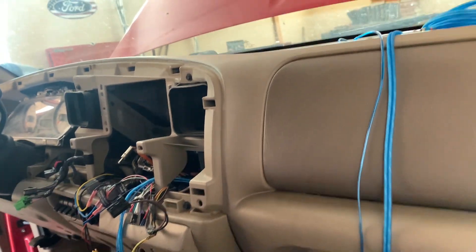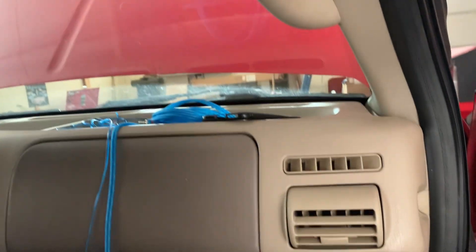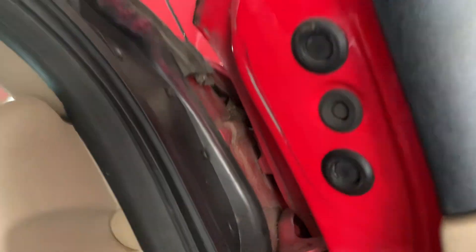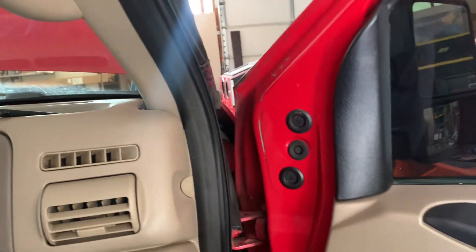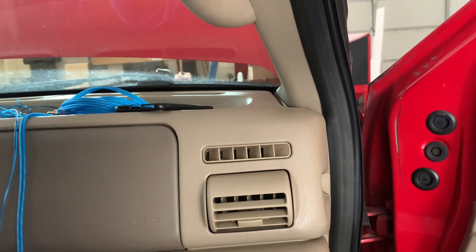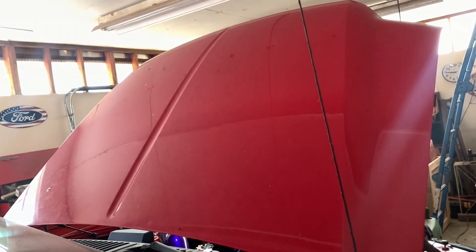Like I said, shouldn't be too bad. Next time I pick the camera up I'll show you all that, and then in a few days — or maybe even today if we have time — we'll go ahead and run the rest of this out. I also need to run my power wire, and I'm not running the power wire like everybody else does through that gap. A buddy who helped me run the wiring on the white truck did that and I hated it — we're not doing that again. I'll have to find somewhere to run it through on the firewall, or make a hole in the firewall, get a grommet, and run it through. We'll figure that out.